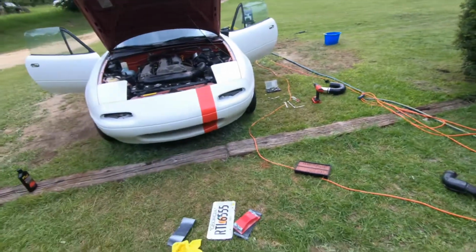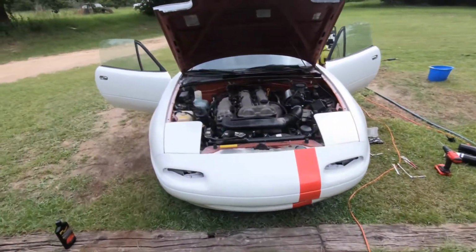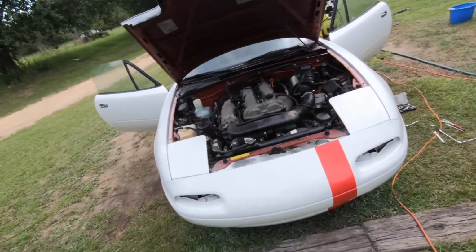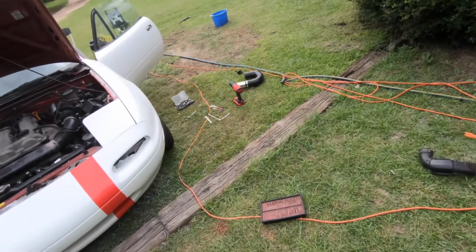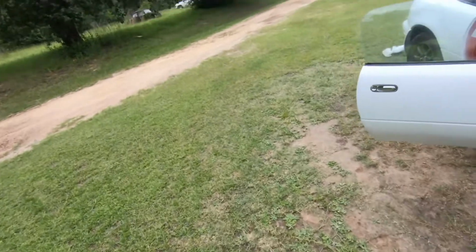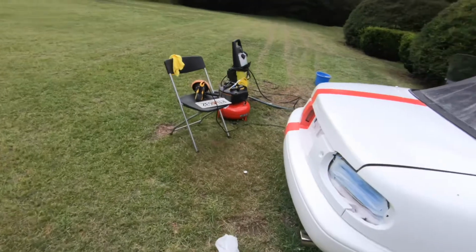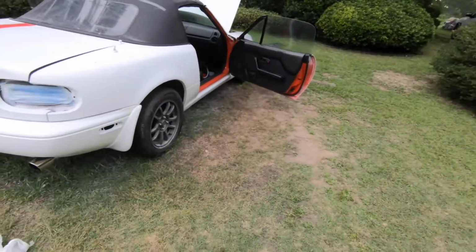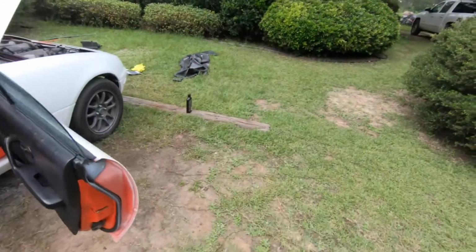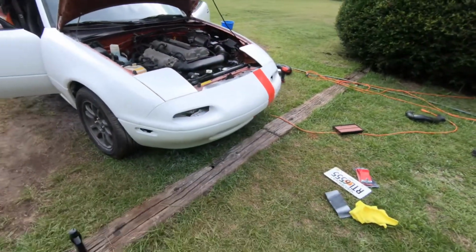So I picked up the rag and I wiped the lenses off on both the headlights, and then set them back down, and then walked over here and flipped my headlights up, because I was going to put them back in. And by the time I came back over to them, they were just glazed over, frosted. The dang acetone had eaten through the clear coat of the lens on them. So I was like, dang, I tried to sand them all the way up to 3000 grit and buff them, but I could not save them. So that super bummed me out. So I'm gonna have to buy another set of those, but that's it.